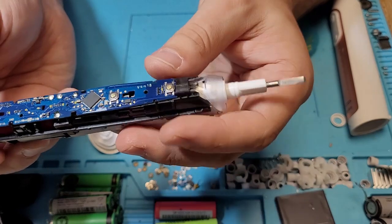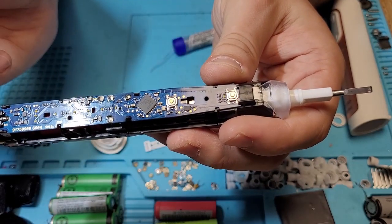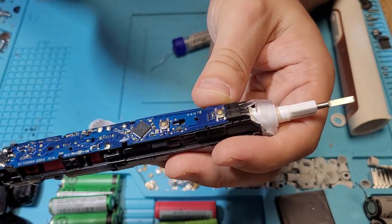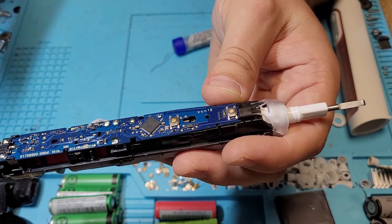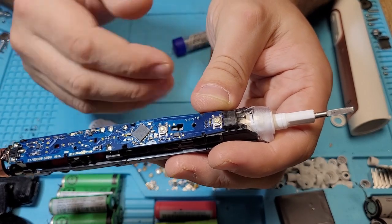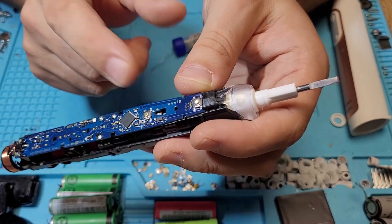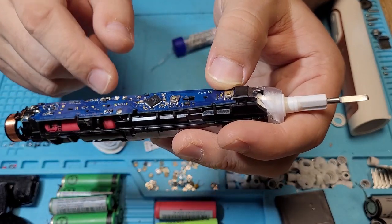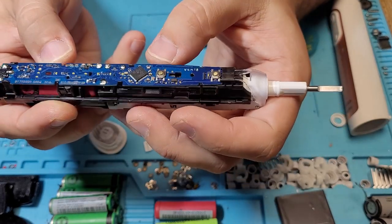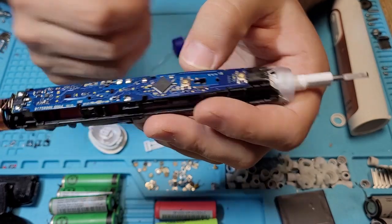In principle, that's all you have to do for this defect — the fuse is defective or starting to become defective. I spotted one thing in one of the toothbrushes: it was working and then slowly died, and after a few presses it died completely. So this could be an additional symptom — if it dies after some time, it's not the battery, it's the fuse.